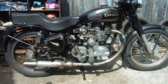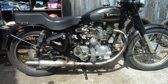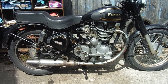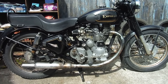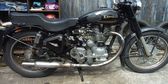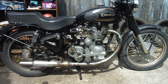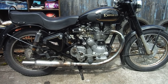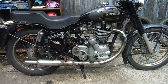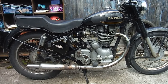I ended up selling it to the current owner who's had it for the last couple of years now, and he decided he wanted it tuned to some of my ASBO specs. That involved a full engine strip so we could get the crank out and lighten and rebalance the flywheels. We also shortened the cylinder barrel and fitted the American-made so-called 9-to-1 piston that Hitchcock sells. By the time you shorten the cylinder barrel, you've very definitely got a minimum of 9-to-1, so that was done, and some more work was done on the head to port it even more than Hitchcock's did.